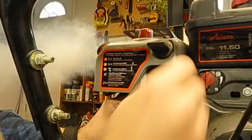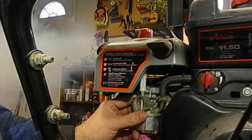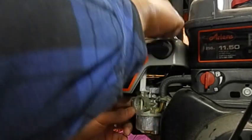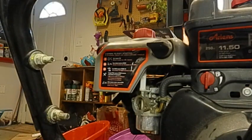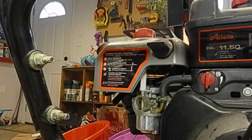A little bit of sputter — good sign. I moved further and while holding the electric start, I realized this was in fact the carburetor. I also — somewhat idiotically — had the fuel valve off. I thumbed over the choke to give it full suction to try to open the idle ports and idle jets. It started to run. Some people would say lucky guess, but I've been doing this a long time. Bumping the throttle caused it to immediately stall, further confirming an idle jet issue in the carb.